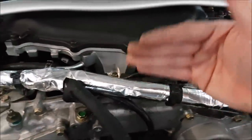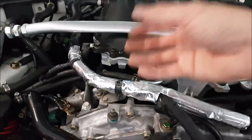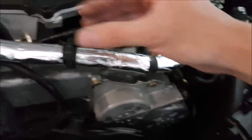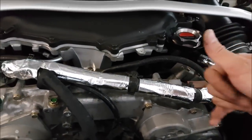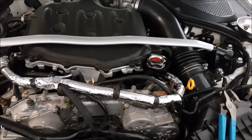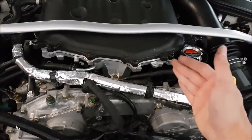We are done with this part. This is the part that will be underneath the cover, which is where I think the heat is going to get really trapped. If you look at other parts in the engine the tape feels soft because the heat can just go around it. Over here when I tried removing it you could hear crackling and it would start to split — I think that's mainly the tape but the loom might have been starting to split as well. By putting this on top we're going to prolong the life of everything. Especially for you guys in humid areas — rubber and plastic parts can just fall apart in engine bays. By reducing the heat here you can get way more life out of the insulation.